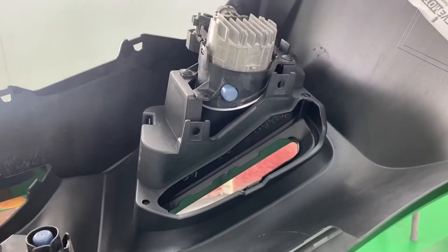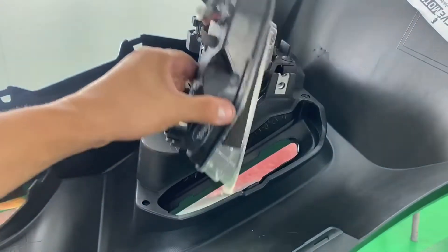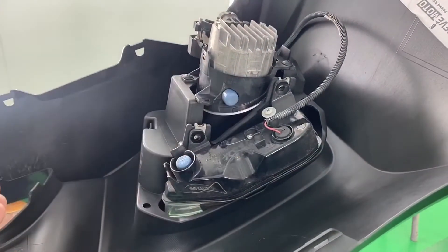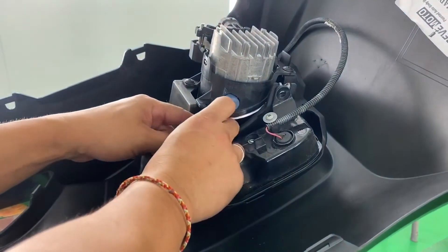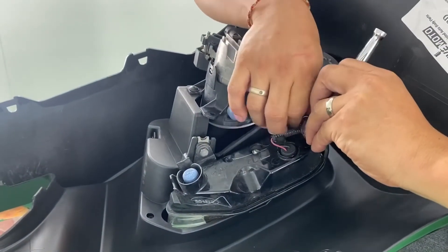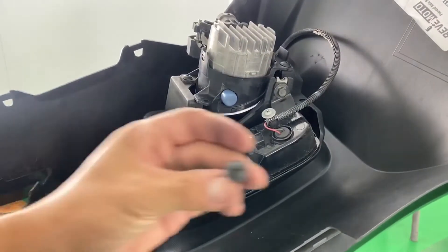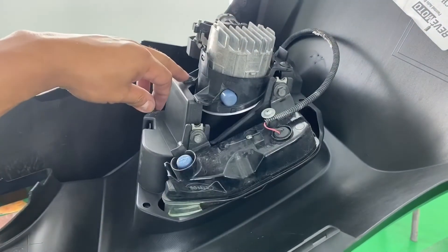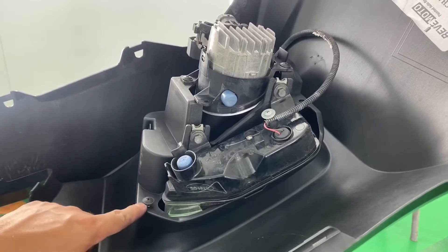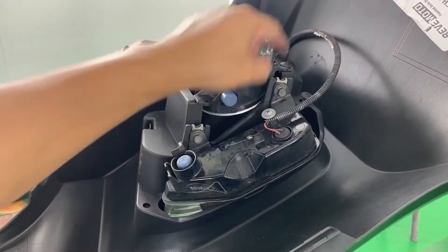Next, the turn signals. Put the clips down first, then slide it in like this and you'll hear it click. Go ahead and put the bolts in. You're going to need the screws for the fog lights — get those at the local dealership. With the new bezel, you're going to have to put those screws on this side, up here, and then one more in the back.